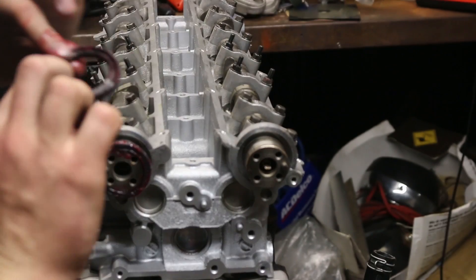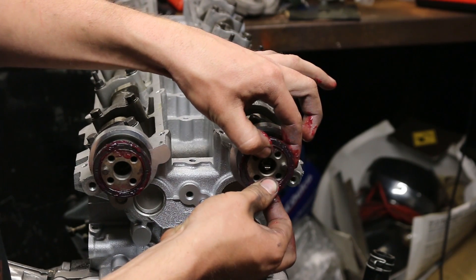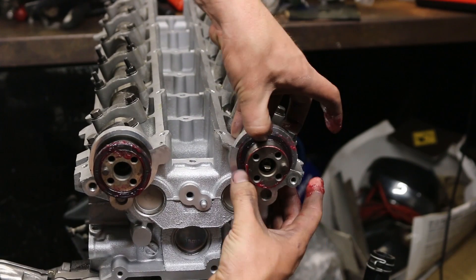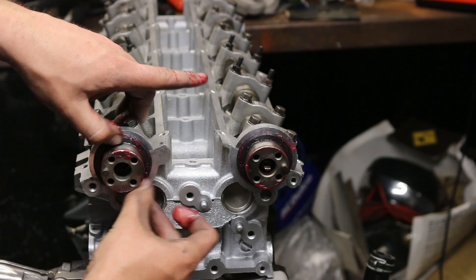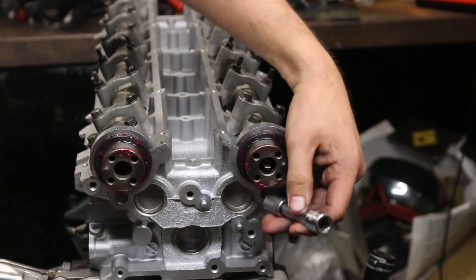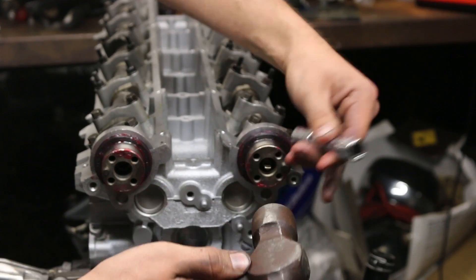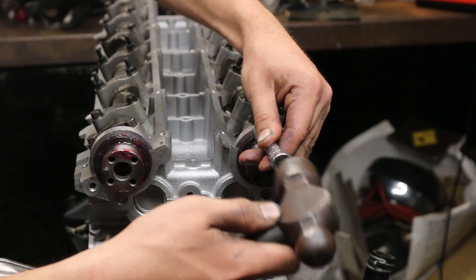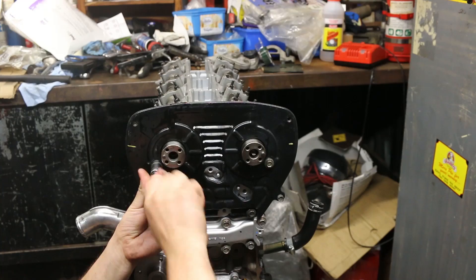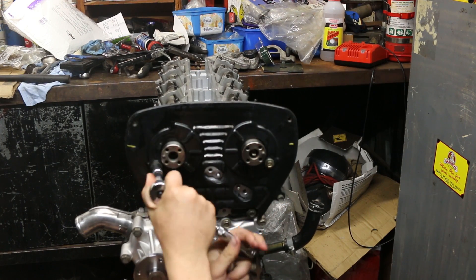As they say, don't go in dry — so we've lubed it up. We're just going to gently hook it around the edge and push it in. We've got this one up on here as well. We're going to use a socket and an extension and just give it some light taps, trying to go in evenly. We want to get these seals in place without tearing or catching on anything. We coat both the seal and the camshaft in rubber grease. It's probably safer to use the blunt end of an extension bar. Just take your time and make sure the springs haven't fallen out of the seal.